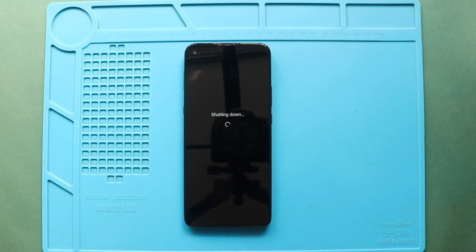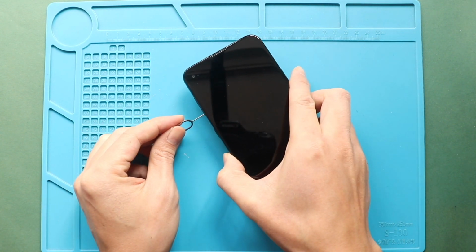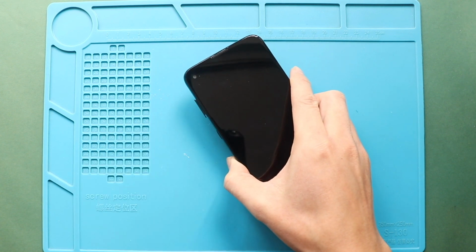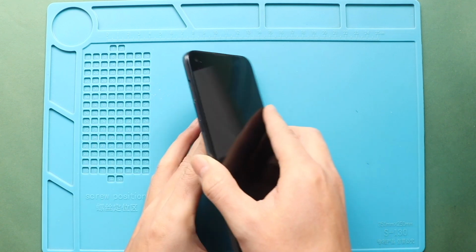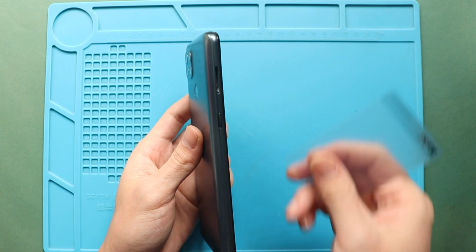Today we will show you how to replace the charging port board on the Motorola Moto G9 Power mobile phone. To start, we need the right tools to proceed with the repair, which you can find in the description. First, turn off the phone and remove the SIM tray, and then follow with the back cover removal.